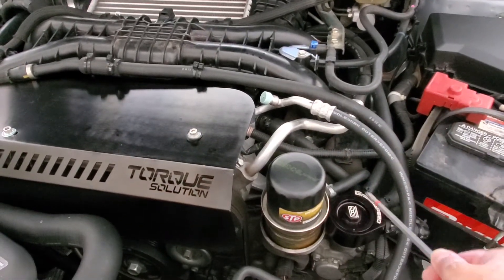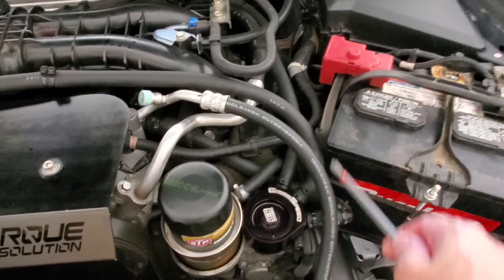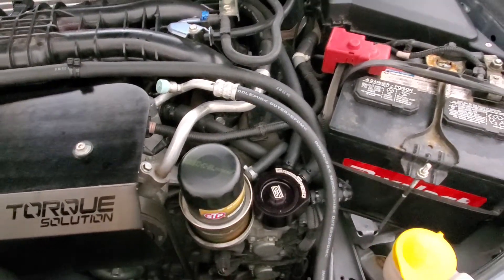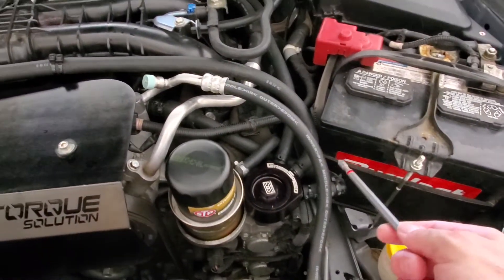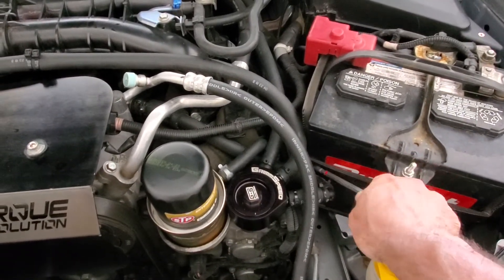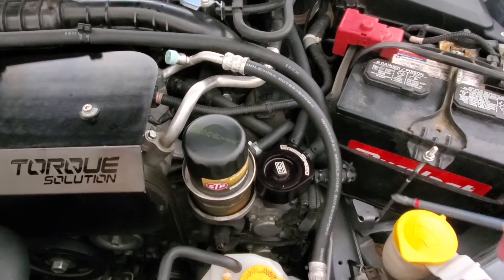This will pull up through the bottom of this center unit. These two will go through a baffling area where the oil pulls, collects, and drips down, and that is pulled in by the inlet vacuum or negative pressure — lower pressure than what's coming in, so it'll draw in that blow-by.